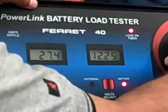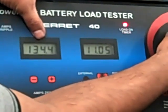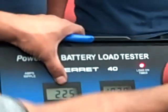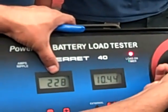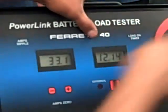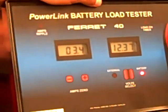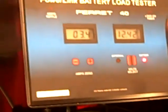It's going to start beeping as soon as I start. You're going to smell some burning stuff coming out of here because it's got a carbon pile in it that loads the battery. I'm going to turn this until the amperage reaches 275. It's kind of tricky — real delicate. That's pretty close. 10.23 is what I'm reading. When it starts beeping, a solid beep, I need to keep my eyes on the voltage and see how low it goes.